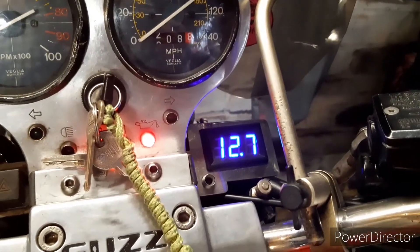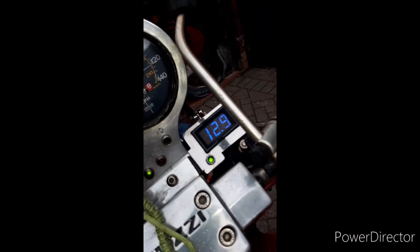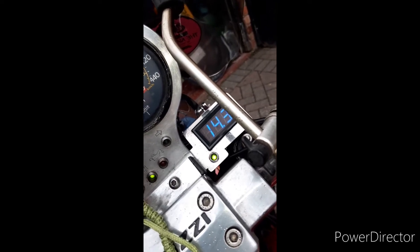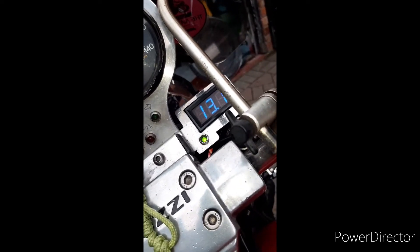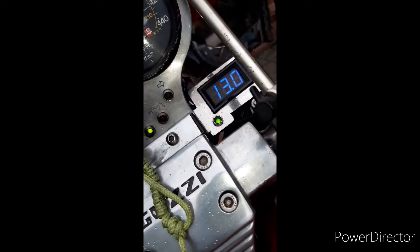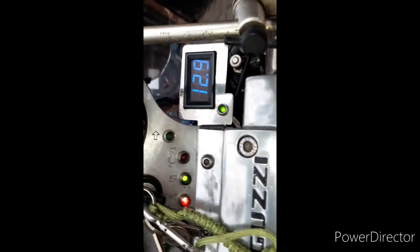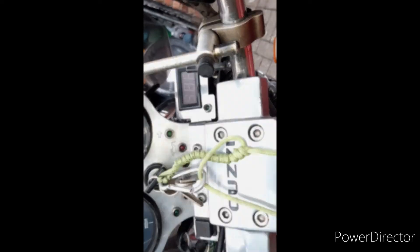The next check is just to verify that the charging system is working, so we'll start the bike. Because this is an old bike, at low revs it's really not going to be charging anything. It's not until you rev it that you're going to be able to see if the alternator is working. We can see the voltage is definitely climbing up and stopping at about 14.3 volts, which tells me the regulator is working just fine. If it were to go above 14.3, we'd know the generator was working but the regulator was not working properly.